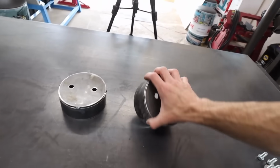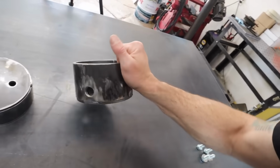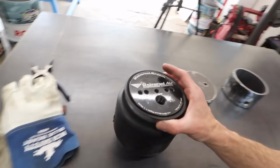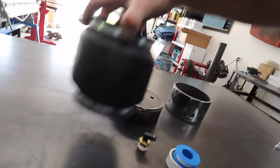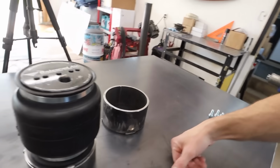All right, well, I have the first pair of rear brackets welded. I basically just tack welded them. They'll hold the weight of the car, and once we know for sure these are the heights that we're gonna want, then I'll finish weld them up. Once we get this whole thing assembled and in the car, I think I'm gonna wanna put some shop air to them to articulate the suspension so I can see what the bag does over the side of the plates, essentially, at full lift and at full compression.